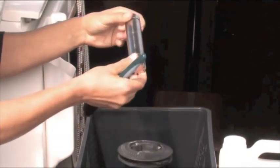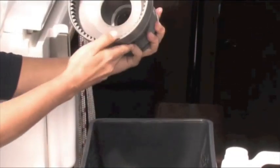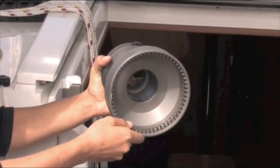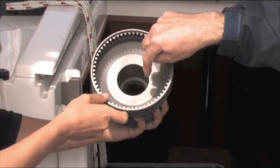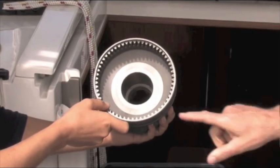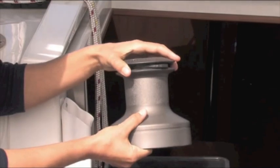That part is easy to clean — always leave it to last. And inside the drum, it's good to give it a clean as well. Especially on alloy drums, it's worth looking for wear inside the drum bearing. Because it's anodized and takes a lot of load, if it's not greased regularly you will get the anodizing breaking off. So let's check the condition of the drum.